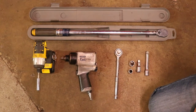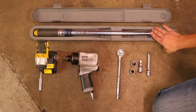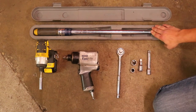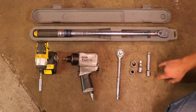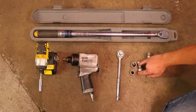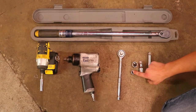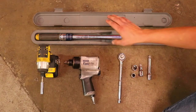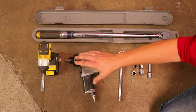We're working on a 2014 Genesis Coupe, so we have one additional tool to explain. We're going to use a torque wrench set to 130 foot-pounds — the book says 125, but we're doing 130 so that if it backs off slightly we'll still be at torque spec. We're using a half-inch extension, a half-inch mini extension, a half-inch 19mm socket, a half-inch 14mm socket, a half-inch ratchet, an impact gun, and a Dewalt impact driver to remove the skid plate.